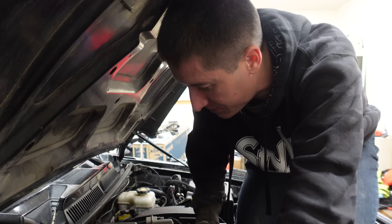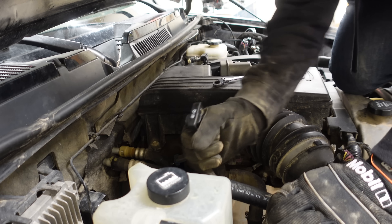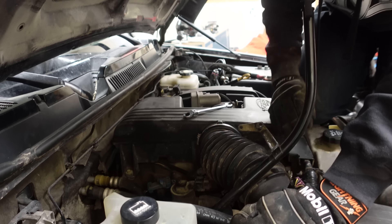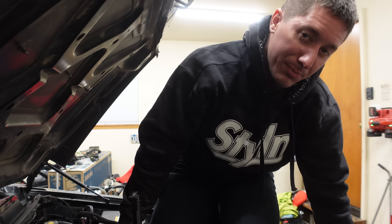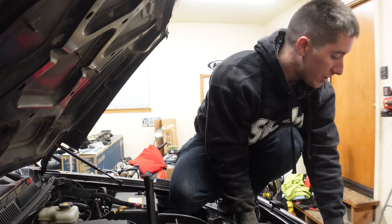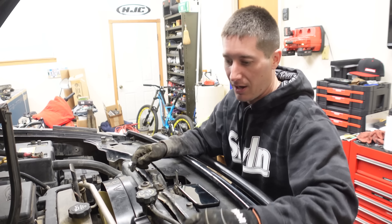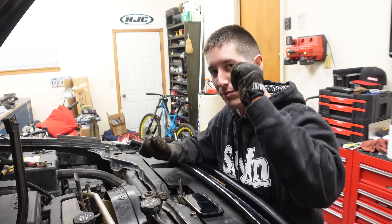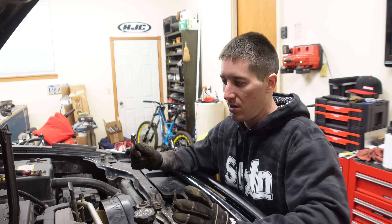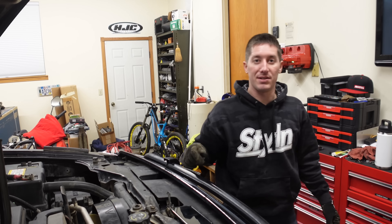We just pulled the tin out of the dipstick bracket, so the dipstick is out of the way — all the way out. I also just got the clips off the cooler lines and got the cooler lines out; they actually came out pretty well. Usually I have to fight those for a long time, but today I was able to get a pry bar in there and get a little pry on them, give them a wiggle, and they came right out. So cooler lines are out, everything's out. We're going to leave the converter attached, slide the transmission right off it — that's the only way this thing's getting done.